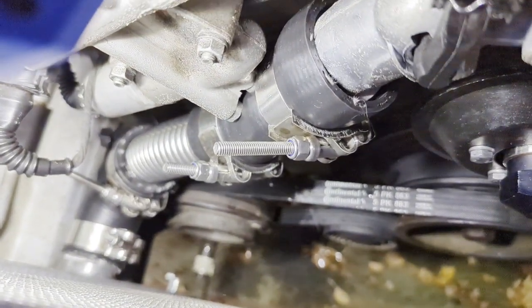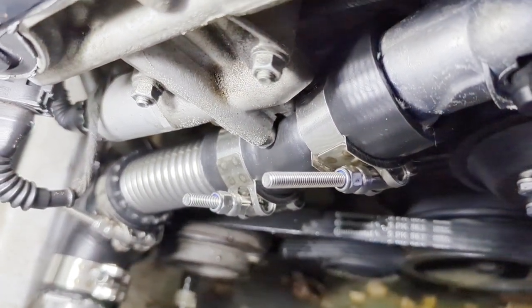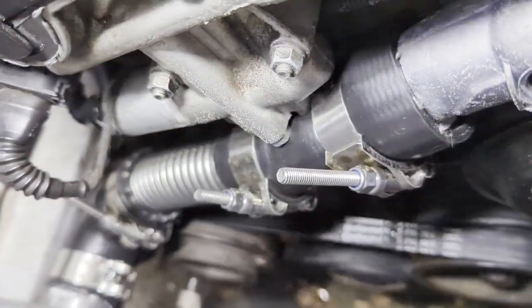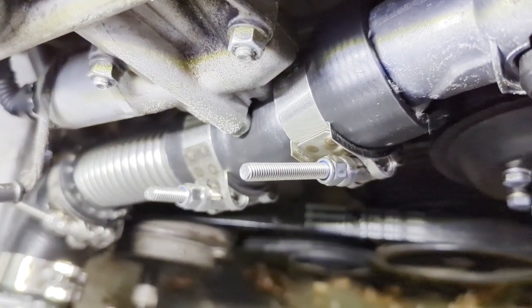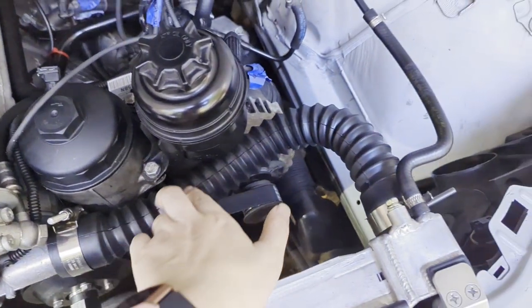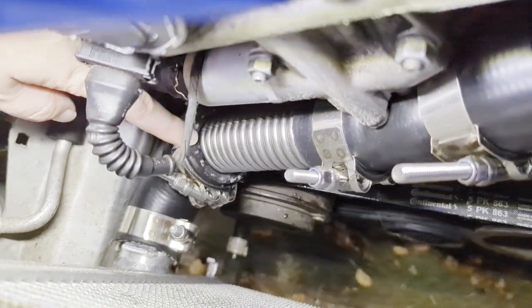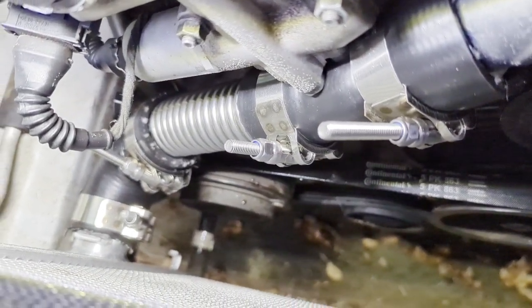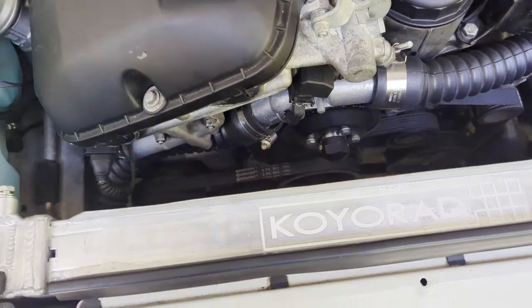My microphone wasn't on, but as I was putting in the second gallon of water I heard water leaking. I went to investigate and found it was leaking from the thermostat into the lower radiator hose — a makeshift connection I had put together. The upper radiator hose wasn't leaking, but the lower one was not working. It was even leaking where it was clamped, so the clamps weren't working either.